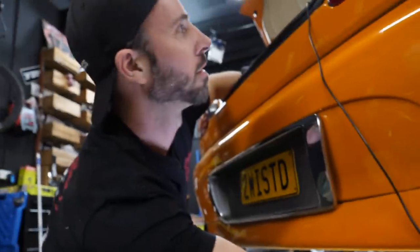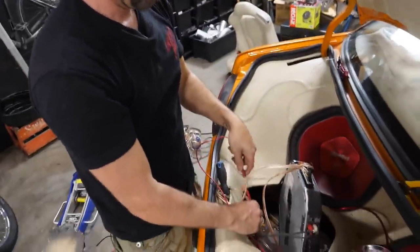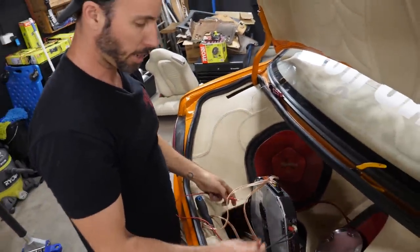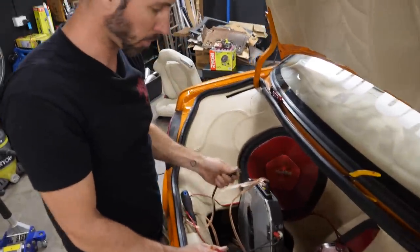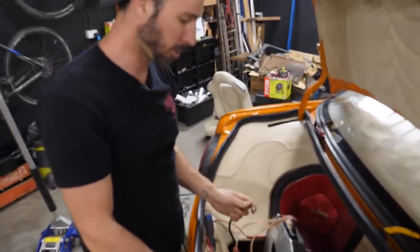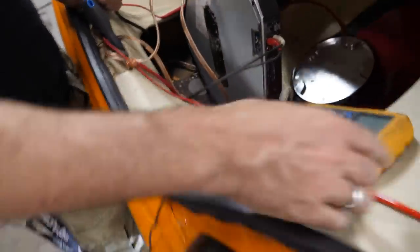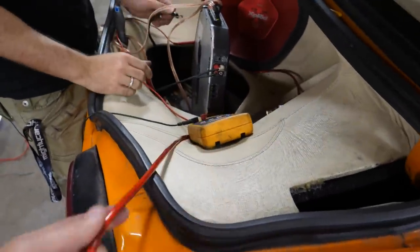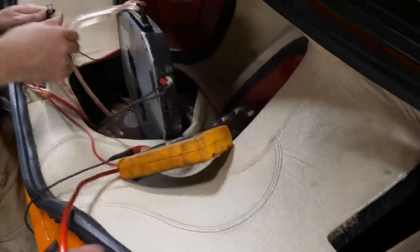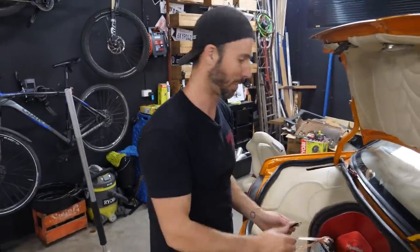Automotive stereo archaeology. Cool. So we know that one would have been power if there was a battery under the car. This one is ground no matter what, because it's connected to the car. So as you said in the first place, Martin, you're absolutely correct: we put a lug on the other end of that and connect it to the positive terminal of the battery. This one plugs in. And as long as these are actually going to the subs and they work, then our subs should be working. I'm pretty damn excited, man.